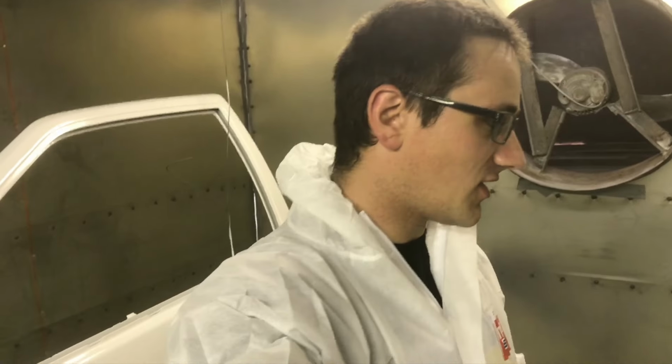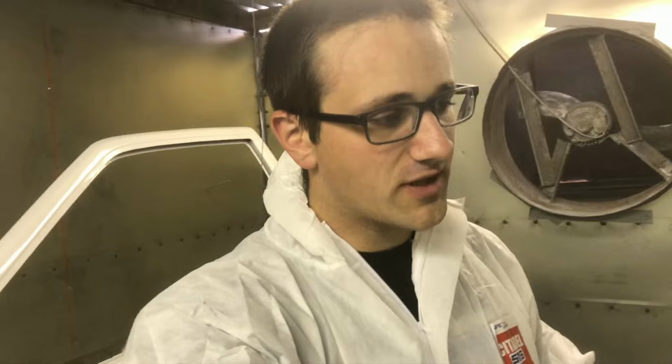Okay, so I just got done spraying the clear over base on the panels, and I'm really, really happy with it this time. I did the same thing on the body, and I did two coats, and it was perfect just like this. And then I did the third coat, and I started getting runs and messing up. So I did two coats here, stoked with the finish, no runs, good coverage. I'll give you guys a good look at it.